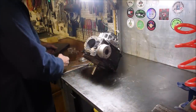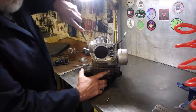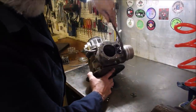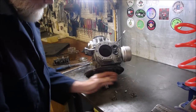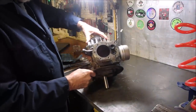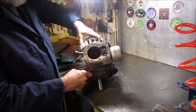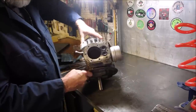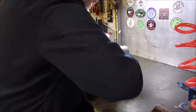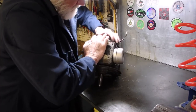So I'm just going to yank the head gasket off. We'll do a light scrape. You guys can see some of this, right? I think the rings are shot. But there's no marks on the cylinder wall, right? Anytime that piston goes down, whether it's sucking in fuel from the carburetor, like that valve's open, right? Or compression, and then explosion, and then intake again, that should suck my hand. And it's not. Right there, I feel just a slight tug.